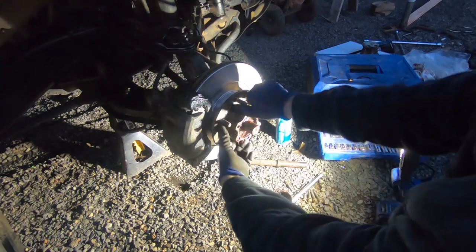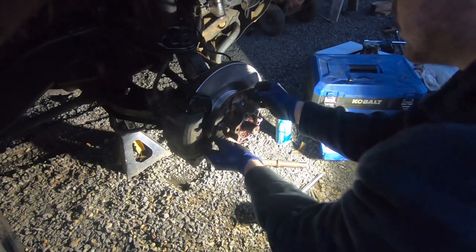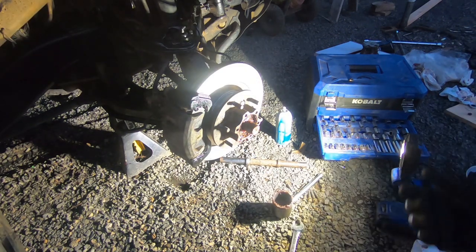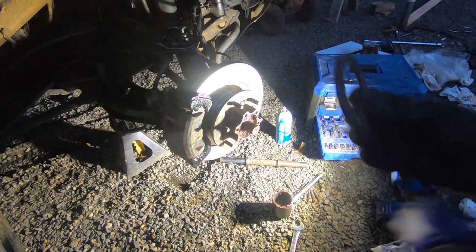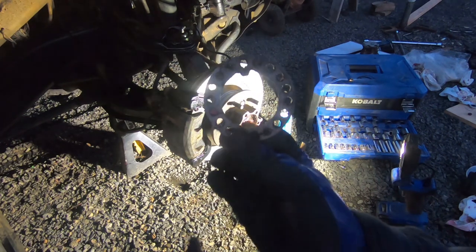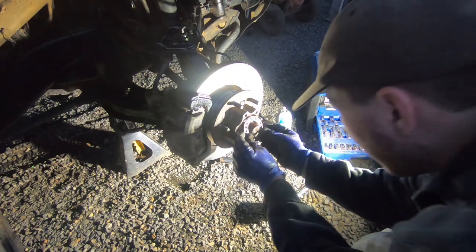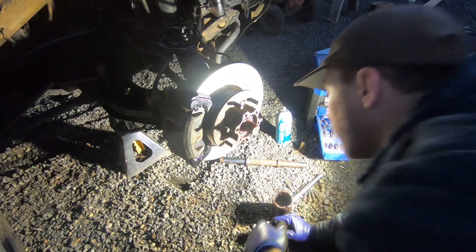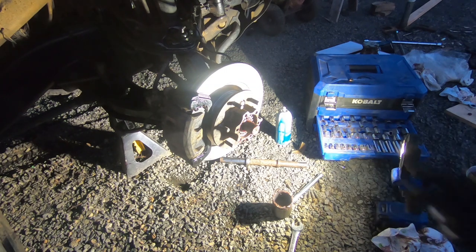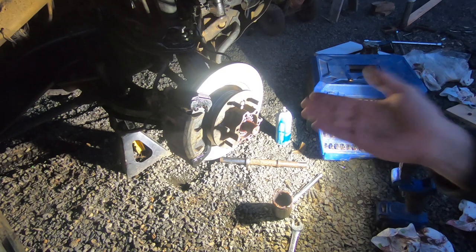This is how it spins — it has brake drag for now, but it doesn't feel like there's any play in it. We'll know more when we put the wheel and stuff on. Now we've got to get this retainer ring on there. It has a little tooth at the top that indexes on the shaft. You try and find if any of those line up with your screw holes and put your screws in. If it doesn't line up exactly, you can back the nut off or tighten it a very tiny amount to get it to work — don't go overboard with it.